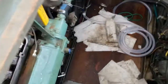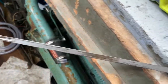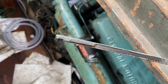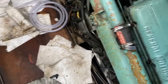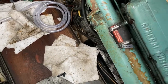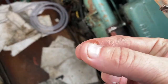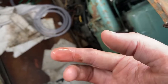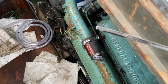I checked the dipstick, and as you can see, it has a little bit of rust, a little bit of corrosion. You can't really see the water in the oil right now — it's been sitting for about a week since this happened — but there is water in there.